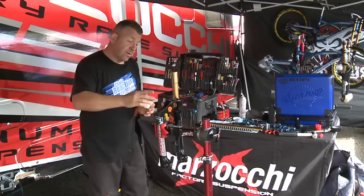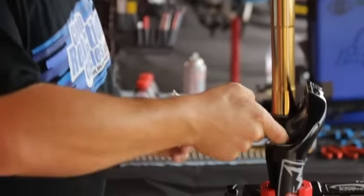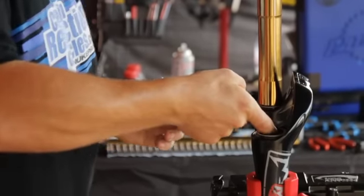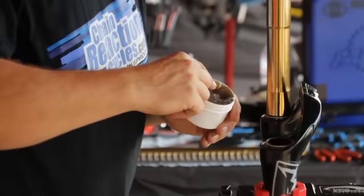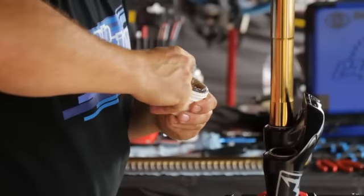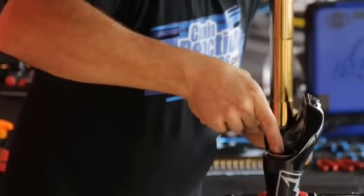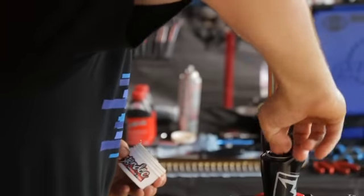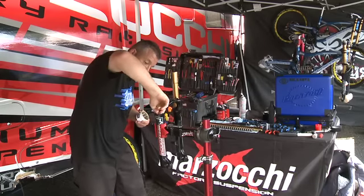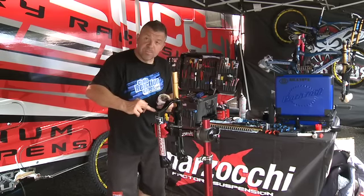One of the most important things for keeping a racer's fork working smoothly for a long period of time: the Triple 8 normally comes with a dust wiper foam ring that sits between the oil seal and the dust wiper. We remove that and use Stendek SuperSpring EasyGlide grease instead. It's a very fine grease that keeps everything working really smooth, stops dirt getting past the layer of grease and into the fork. It's a small thing that makes the fork work smoothly for much longer.